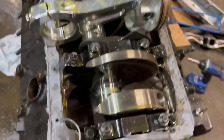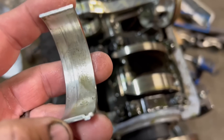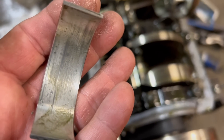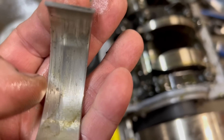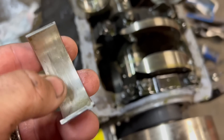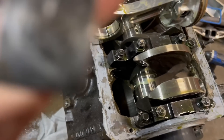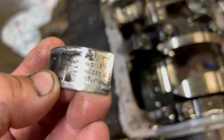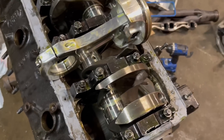All the pistons are out. Only a couple of them look like they were squished a little bit. This bearing is in actually really good shape — it's got a little bit of pitting from some contamination, maybe from the thrust or when I put it together. If you look down in the very middle, opposite side of my thumb, it's a little wider — kind of squashed. That's a little bit of detonation, so probably need to take a degree or two of timing out. These are King bearings, 20-thousandths oversize on the rods.